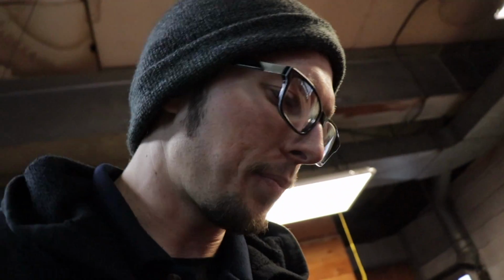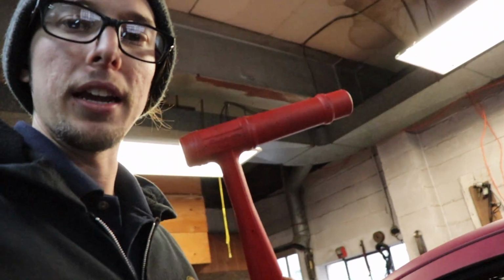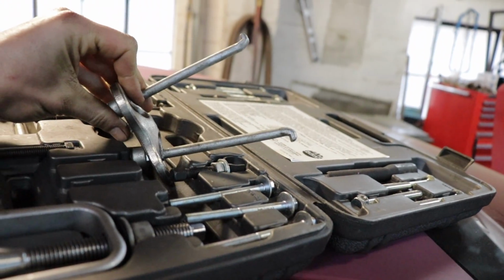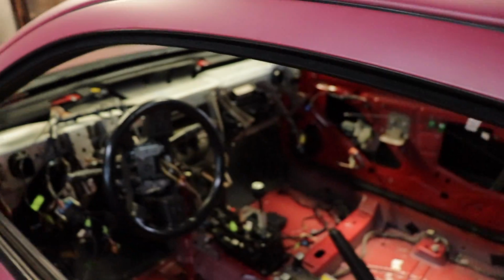So it's been quite a while since I did the first part of the video, mainly because I couldn't get the steering wheel off. I need a puller. What I did try, which I don't recommend trying, is I had a piston hammer that I was using to whack the backside of the steering wheel, and I was hitting it pretty hard and it wouldn't come off. It wasn't working. So I had to borrow a puller kit from another shop that I deal with, and they gave me the puller here. I'm going to use that to pull this wheel off the rest of the way.